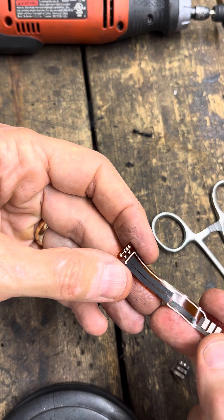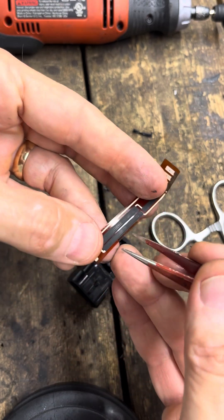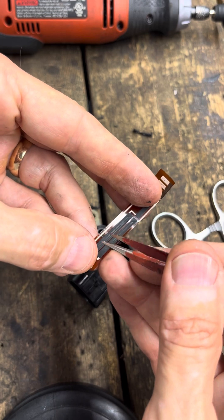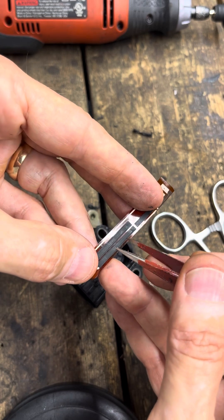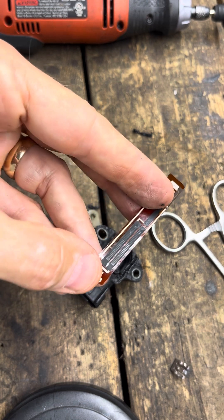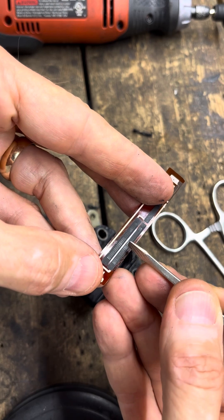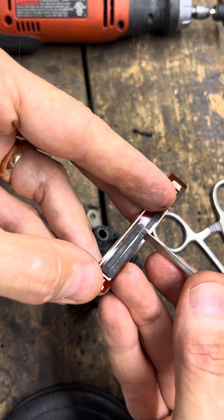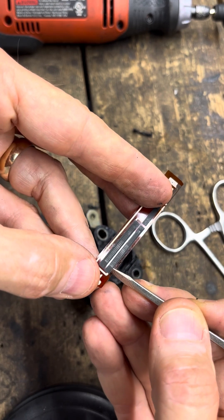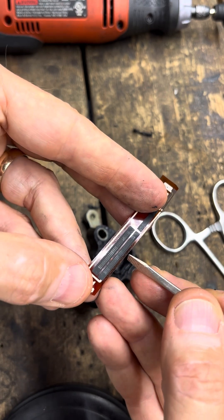This one doesn't look too bad. You can see the little stripes — the three little areas where the fingers run. I had one where they were super deep. Yeah, you can see this one's deeper. This is where it's been running, between here and here. But it can sweep all the way from up here. I think the clutch has a wider sweep than the shift and position sensors.